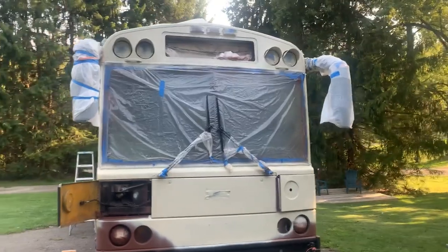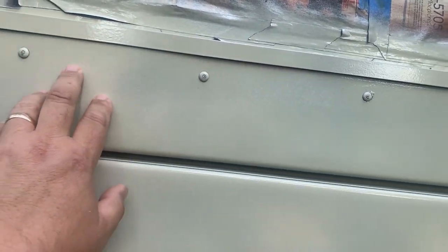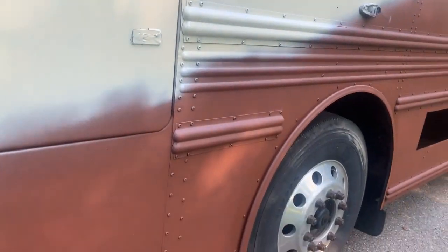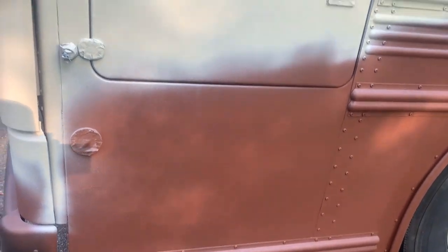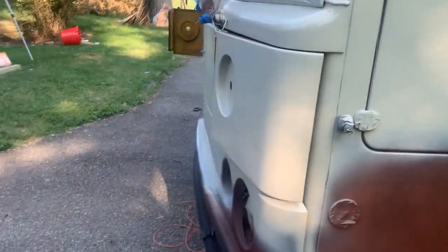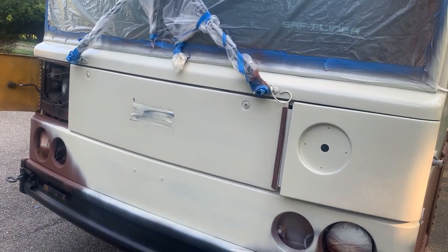After coat one, the magic paint went on the bus really, really nicely. We've gone all the way around and most areas only need one coat, but there are some spots where primer is showing through, so those will get a second coat. We're white from the rub rail up. I'm also going to come back and paint the ring around the wheels to set that off. For the touch-up areas, we hit them with 320 grit sandpaper lightly to take the sheen off, then re-tack clothed it. We're about to put the second coat on.